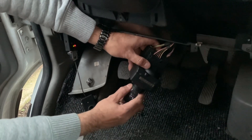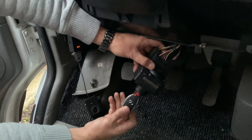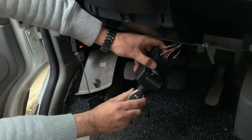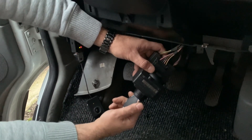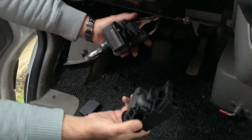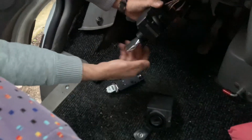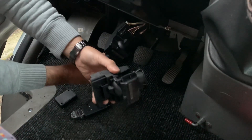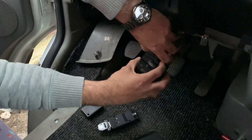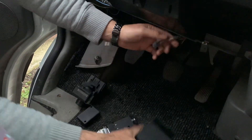After the sound, you can take out the key, then put it in again. Plug it in one more time until it's fully programmed. We can try to start the car — this is with our switch and our emulator. Here is the original one with the original key. Turn off the car — you can go to your garage, program a new key on this switch, and then start the car again. Even if you bring it back, everything should work as normal with the original switch.